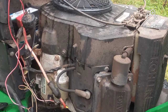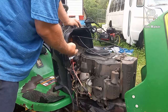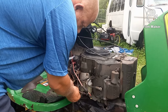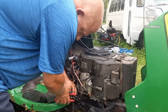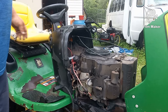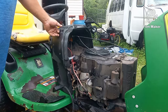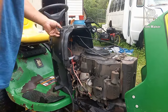All I've done is take the positive wire from the switch and run it directly to the battery. The original wire right here is dead, so I'm just tying it off and cutting the end just in case it causes a bad connection later - we'll tuck that out of the way. Now when I hit the button with the key on, we're getting straight power. The key on - it would start. I don't know how long it's been sitting or if there's fuel, but at least now we know our starter issue is fixed.